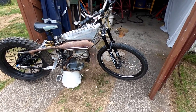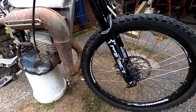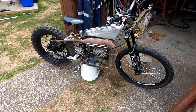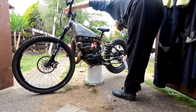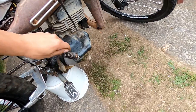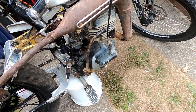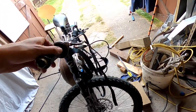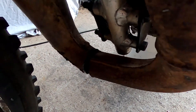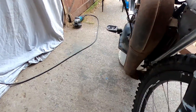I'm kind of ready to give her a first start. I can't ride it like this because the front wheel's no way near going to clear when the suspension goes down, so I'll have to move the expansion chamber but I'll just give it a start up on start spray. Even with this kickstart I don't get the full throw out of it but it's enough to start it because it's so easy to start. I cut the pipe through there, bent it around, and also cut it down the bottom there - and she clears just.